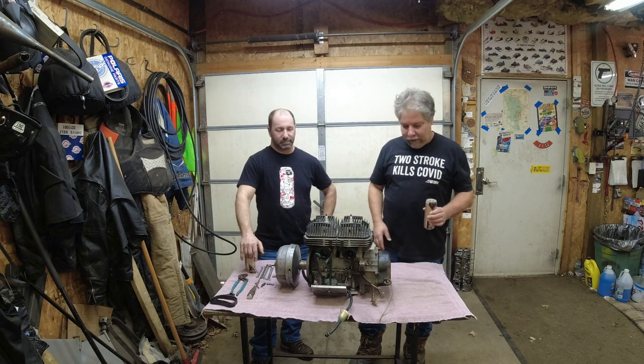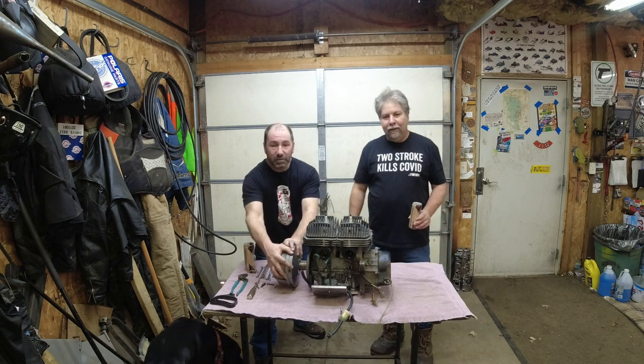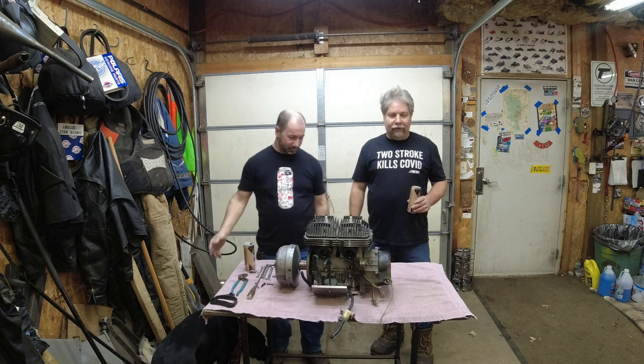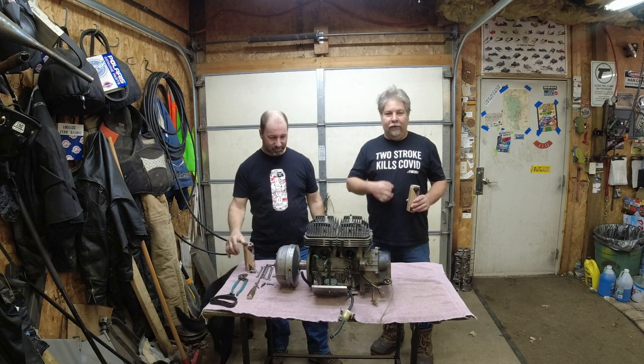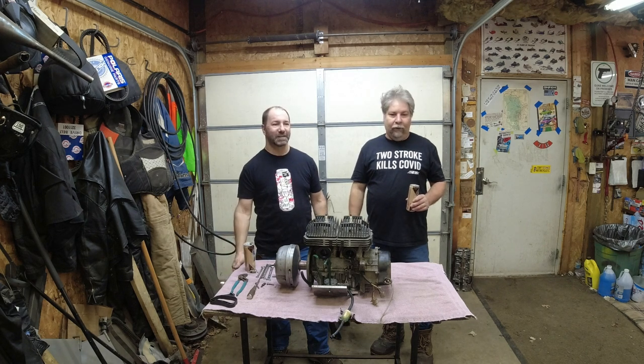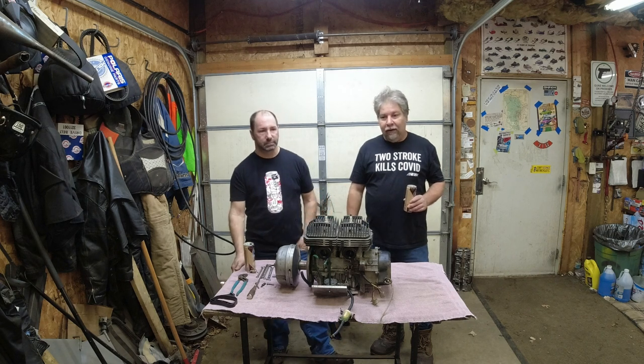So, motor came right out, and the reason it's coming out, well, you want to demonstrate? She's a bit locked up. So, I was doing some carb tuning on it, and it was sitting there at idle, and all of a sudden it went rattle, rattle, rattle, clunk, and then it would only turn backwards and not forwards. So, our suspicion is that the crank bearing, most likely at the PTO end, has...